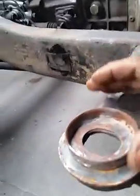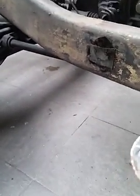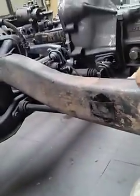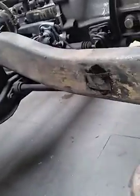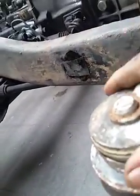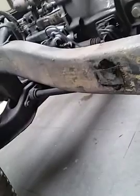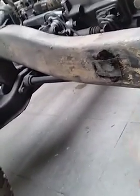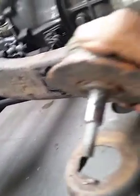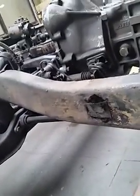You have to grind it here and keep this in this position, like this, and do the tack welding, then put the vehicle back and do the necessary welding. But finally we're going to fix it like this. These things have to be properly done, because there are 12 mounting brackets like this. Here you can see it is broken. This is almost 30 years old, a 1985 model Pajero. So if you want to redo it, this is how you must do your brackets and these things.